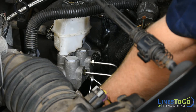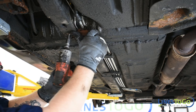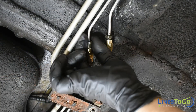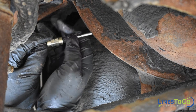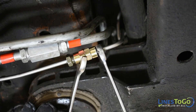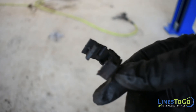Using a 12mm wrench tighten the fitting at the master cylinder. Install the second section of the right rear line into the plastic brackets and start the threaded union behind the front subframe. Using a 10mm and a 13mm socket install the four support brackets holding the lines into place. Install the next section of the right rear line into place and start the fitting by hand. Feed the final section of the right rear line over the rear subframe and start the threaded union on the left side of the rear subframe. Start the threaded fitting into the right rear flex line and tighten using a 10mm wrench. Using a 12mm and a 13mm wrench tighten the unions behind the front subframe and the two unions at the left rear axle. Install any remaining plastic brackets including the two located over the rear subframe.